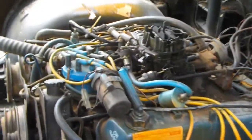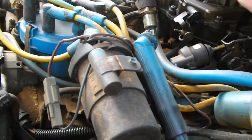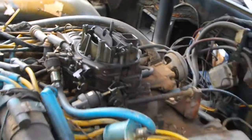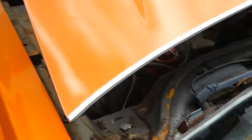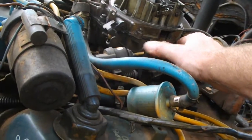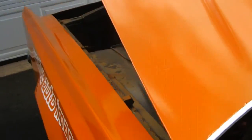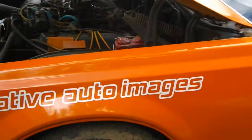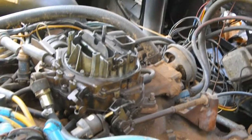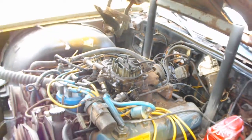They can give this old girl a run at the side by side at the end of the month, and hopefully she works better than she did last time. You can see now she's staying open, and she's hot — she should be. Hopefully it still starts right; I'm going to have to fine tune that a little bit. Way better. Hopefully that helps you out if you're having some choke problems with your Ford carburetor, your Holley 4 barrel. Good luck. See yous later.